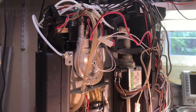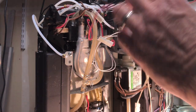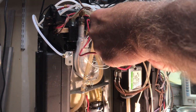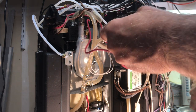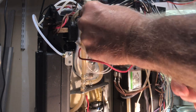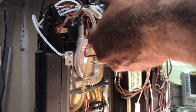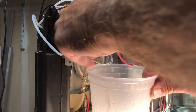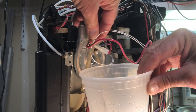To remove the pump, the first thing I'll go after is that top water hose and remove that clip. Then I'll pull out the electrical connections — make sure that the machine is unplugged from the wall. I apologize that this video isn't better; it's just hard to get a good camera angle when everything is so tight. That top water hose just pulls straight out from the fitting. Watch out — there's an O-ring inside that fitting, and sometimes it comes out on the hose, sometimes it flies out into the air, so you have to keep track of it, otherwise that fitting will leak forever.